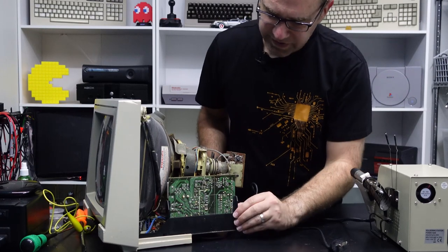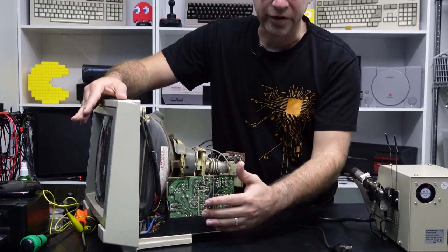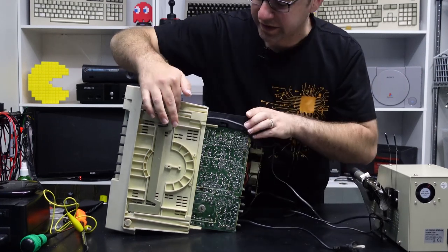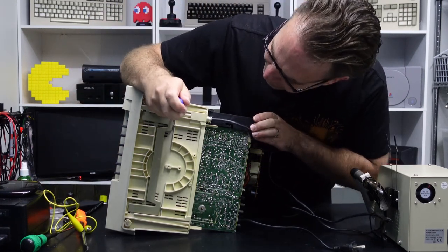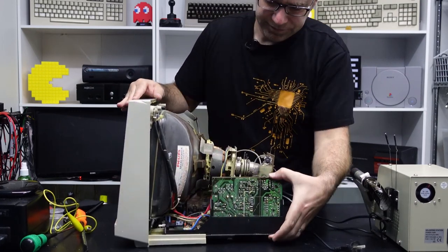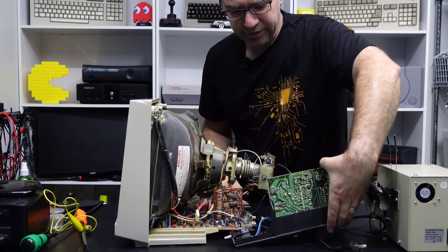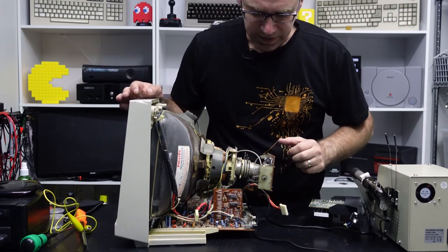Let's start with disassembling things and pulling stuff out. The power supply board — it turns out the other one actually had a broken clip underneath the supply board which is supposed to hold it in. There's a little clip that needs to be pushed in to slide that board out. We also want to disconnect the degaussing coil and the power supply to the main board, and watch out for those big capacitors on that board, just in case they're holding some unfriendly charge.